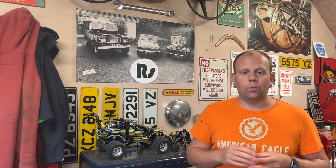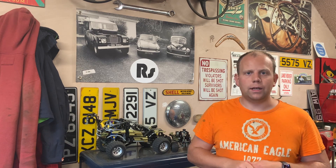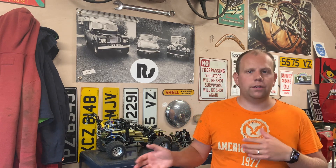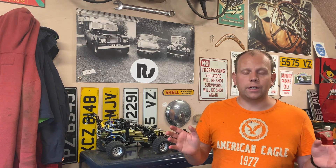Why was I suspicious? Well, there's a little rust stain halfway down the block — there's no reason for it to be there — and there's an ever-so-slight leakage of coolant that I'm always topping up every few months. There's no obvious cylinder head issues, gasket leaks, or external coolant leaks, so I suspect that's where the fluid has been going. With this in mind, let's think about what I can do: possible engine conversion options and maybe even fixing the block.